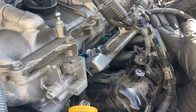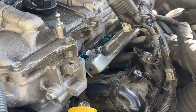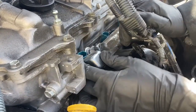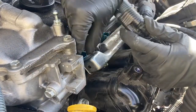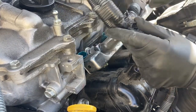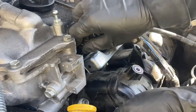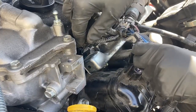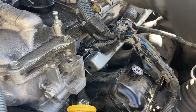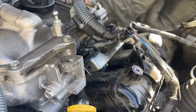I started with the back one and put it all the way in, then slowly worked my way down the rail and held it in to get the last ones. You want to make sure these are all sort of straight to put the connectors back on, and then check to make sure there are no leaks. You can torque the two 10 millimeter bolts to five to seven foot-pounds.